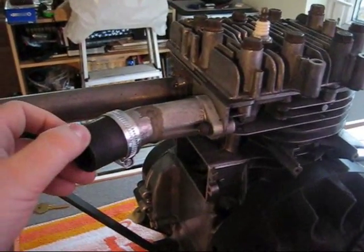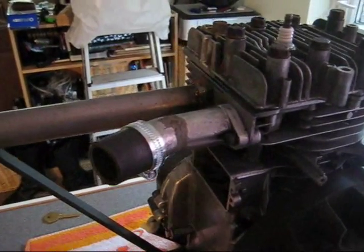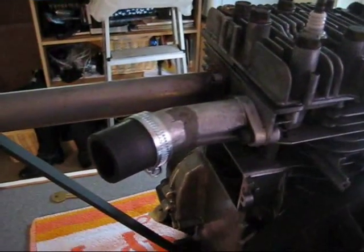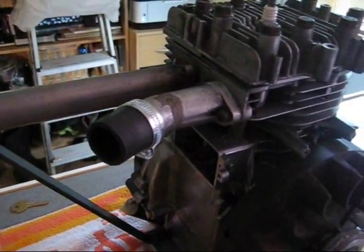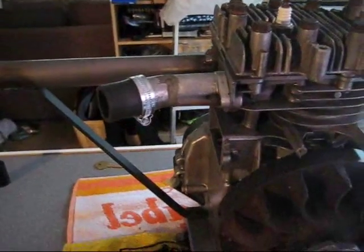I had to cut that, moved it round, put an angle. I got someone to weld it, but because it's cast aluminium it didn't work too well, so there's a couple of pinholes in it. This stuff you can see here is just epoxy that I put on to keep it sealed, which should be gas resistant for a while.